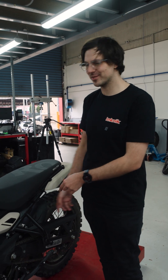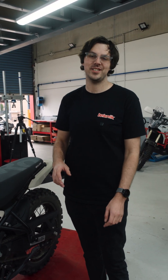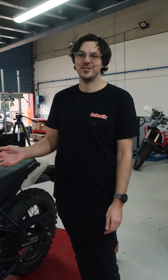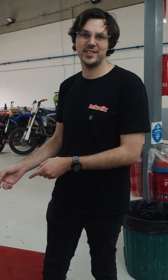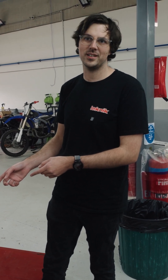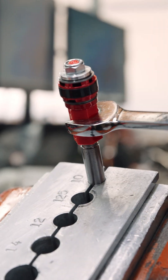From here we're going to pull out the shock absorber and the forks. We're going to test them on the dynamometers, check what size the bushes are, just so you know what they are as well. For this bike we're looking to maybe make a lowering link, so stay posted for that and see about the stock valving on the shock. We may or may not do a kit for that. For the forks, we're definitely making up a valving spec for you guys to come and grab.